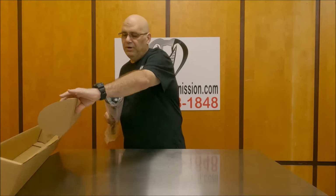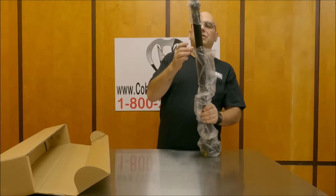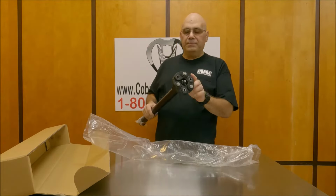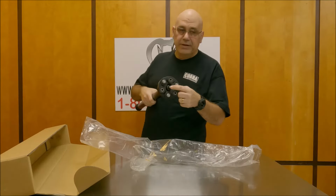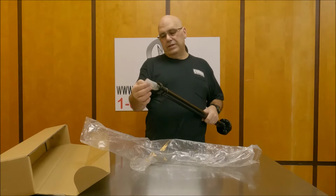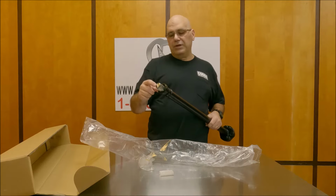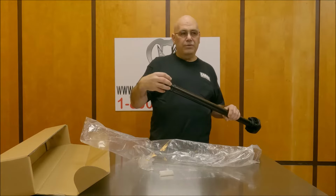We are the first to bring to market an extended drive shaft with all of the components installed. That means that our extended drive shaft is going to have the universal joint. It's going to have the centering flange right there and the protector right in the front. Once again, ours is an inch longer, so it'll go in a lot deeper into the front output shaft of the transfer case. I also sell a brand new coupler.